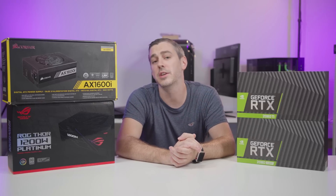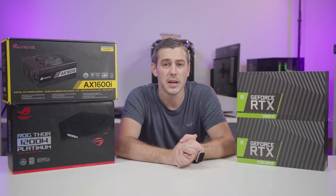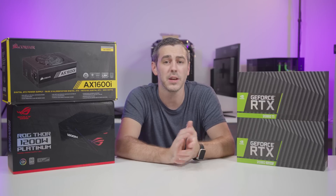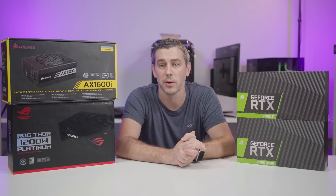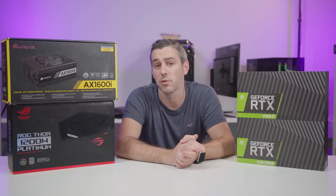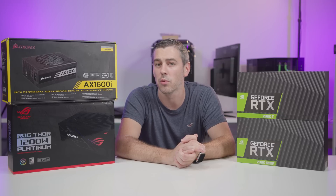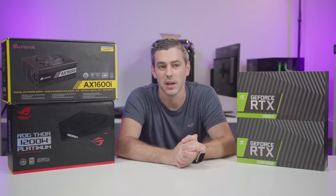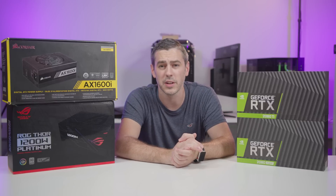The truth is, as I mentioned at the start of this video: yes, no, and maybe. If you are buying a Founders Edition graphics card, yes, it is going to have the 12-pin connector — but Nvidia have got you sorted there. They've decided to bundle in the 12-pin power connector adapter that will simply plug into your existing power supply and work flawlessly with these new graphics cards. It is worth noting that the community doesn't really react well to new standards or new connectors, so it's very interesting that Nvidia have decided to take this bold move. But from the call we were on the other day, it seems there's very good reasoning behind it.